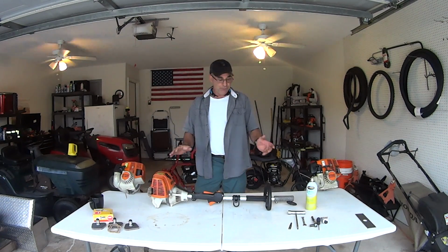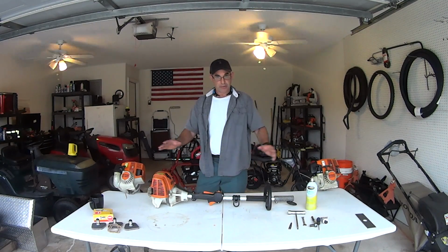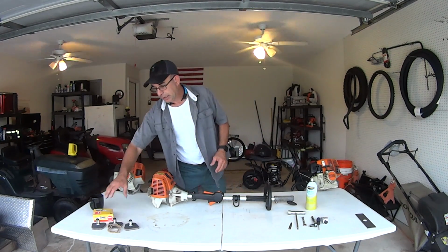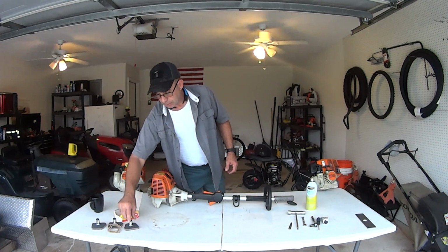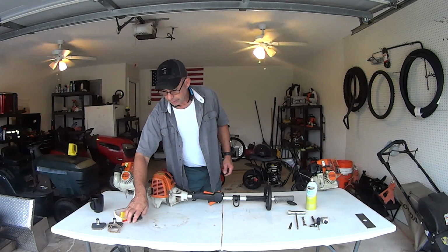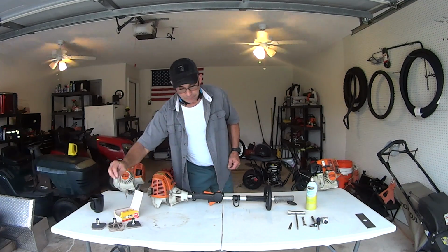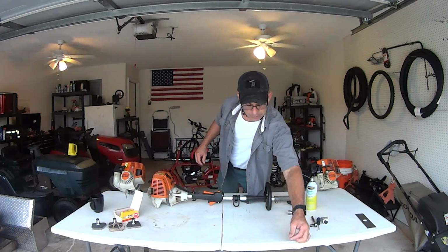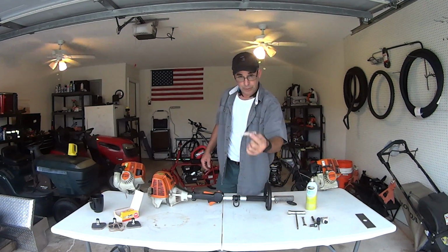So if you go to your Stihl dealer and you say, I need a spark plug for my, oh crap, I don't remember what I have. It could be a 90, it could be the 100, and I believe the 110. They all come from the same family. So you can get spark plugs right here. They're all the same spark plug. Fuel filter, they're all the same fuel filter. Air cleaner, they're all the same air cleaner. And valve cover gaskets, they're all the same valve cover gaskets. And they use the same size feeler gauge for your valves.